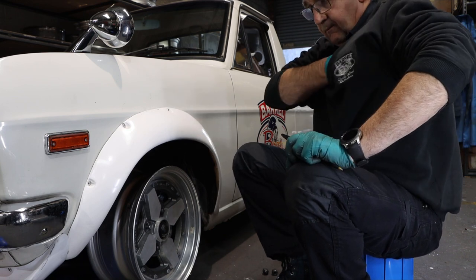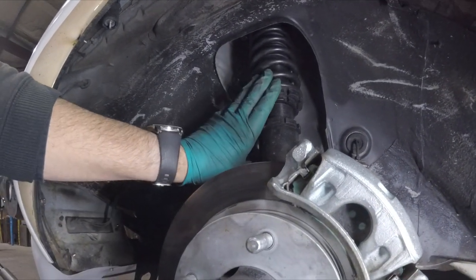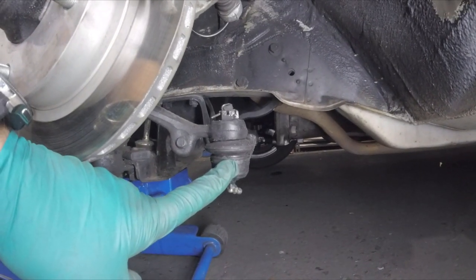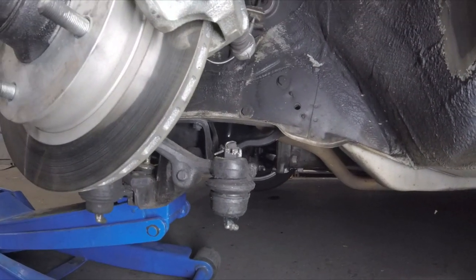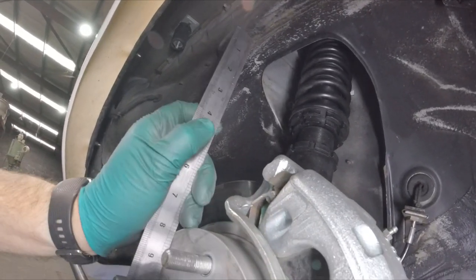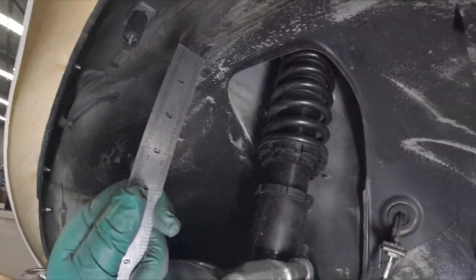Okay, now I'll show you how to do the inside. Let's have a squeeze underneath here. So just eyeballing it, it looks like we've got two areas that are closest to it, which is the strut here and the steering. So if we clear that, then that's the one we've got to worry about. The trick is, you put a rule up across your hub so it's nice and flush across the hub, then measure from there back to the strut.